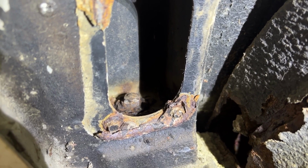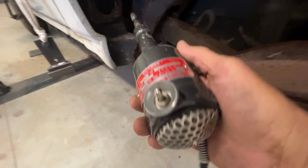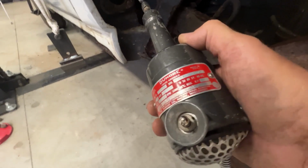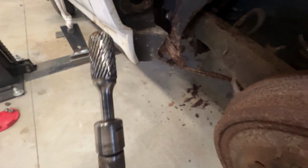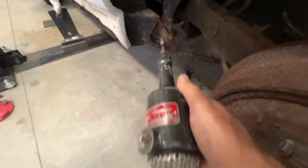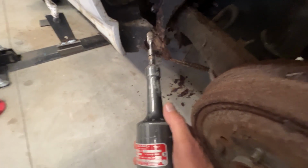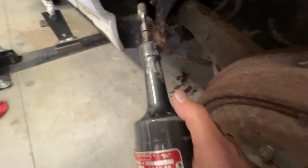These are the last two bolts I need to get before this body comes off. This is what I use to grind the bolts off of the body to frame mount right in front of the rear tire, both sides. It's pretty aggressive, it's for roughing out cylinder head ports, cast iron and aluminum. Yep, just an old Dumore grinder I picked up at a yard sale for about 10 bucks, believe it or not. But I had both of them off in about 5 minutes, very quick. So thanks Mid-Year Mitch for the heads up on how to get these bolts out.